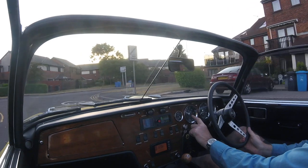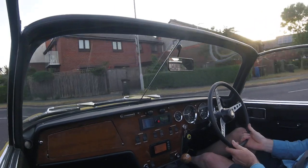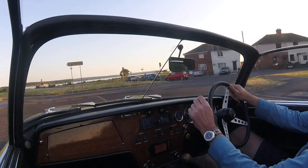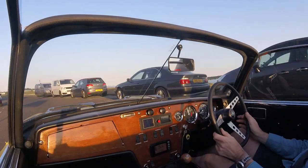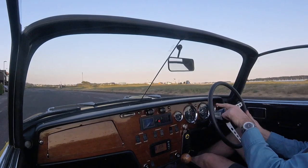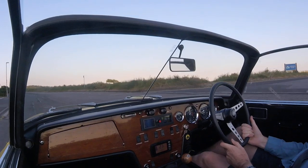The RPM meter is actually running twice what it should be, except that's actually the more genuine RPM down here. So we're not actually doing 4,500 — we're actually doing about 2,000 RPM as a state. We need to tweak the tacho to make it read correctly at half of that speed.